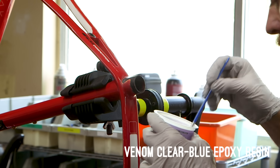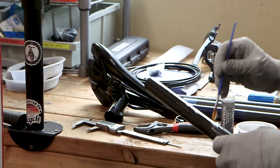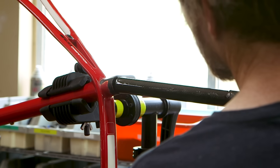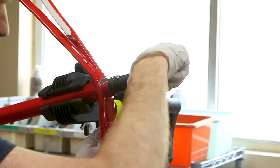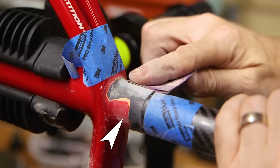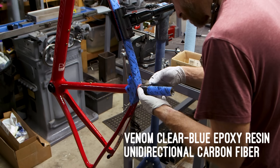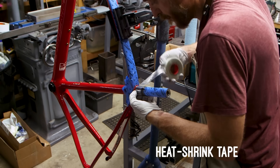I am using the same two-to-one epoxy that I used to bond the tubes together. I want to make sure there are no air bubbles in this bond, so I started by coating the inside of the seat tube with epoxy, then coated the new carbon tube with epoxy and pushed the two together. As I inserted the tube I rotated it to help work out the air. I let that epoxy cure for about 48 hours. Then I mixed up some hard-set filler and filled in that original relief, let that cure, and sanded the filler to shape.